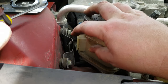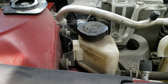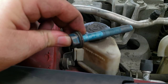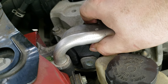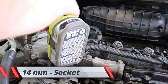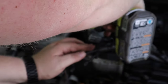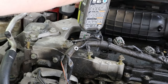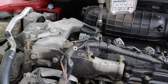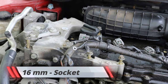There we go. This little tab here — you want to push it back, and that should give us access to get this bolt out. Get a little WD-40 for good luck; that should break it loose enough. There it is. This one you can remove. Here's the crack again — I need to replace this going forward; that's just something else I've got to do. Don't forget this bolt. Now we're going to go ahead and loosen these four, and that should free the engine mount.